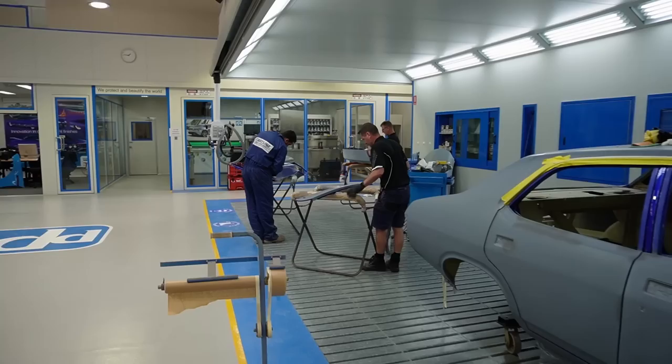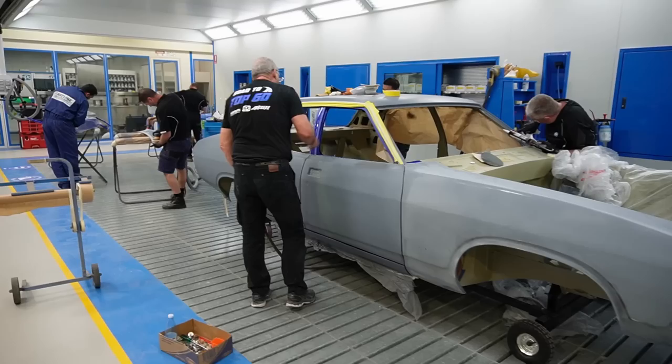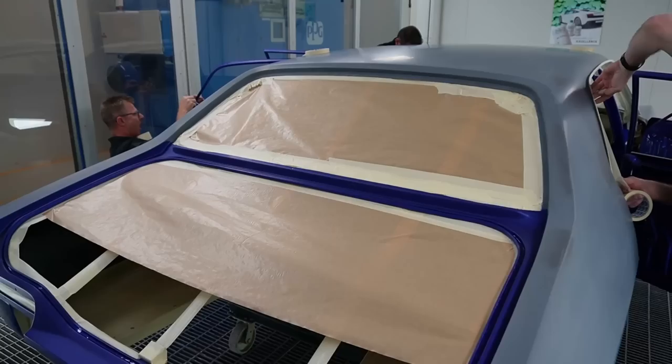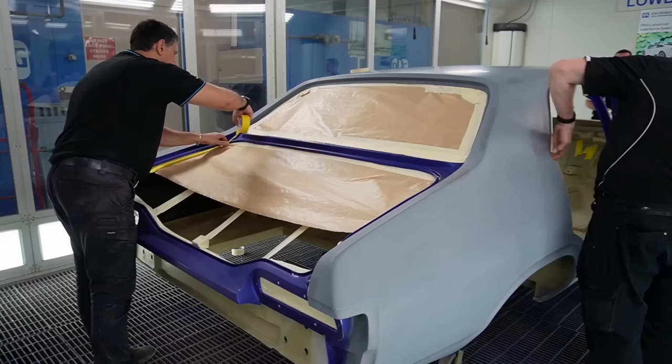So you can see there the guard's been rubbed and we're working along. I'm still fitting gutters, trying to get panels on. As the boys finish rubbing the underside, then I'm putting them on the outside. So we're heading towards masking now. The next process is we'll get it all cleaned up, masked up, and then get the colour and the first lot of clear on. Make it look pretty. We're doing it closed door, to make sure the colour's consistent.